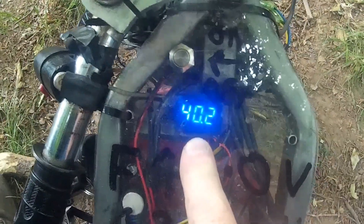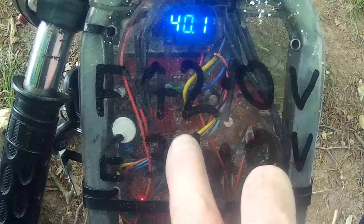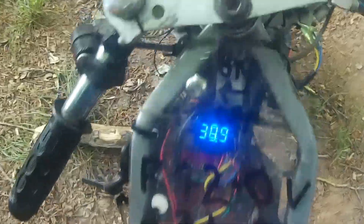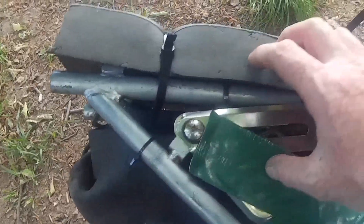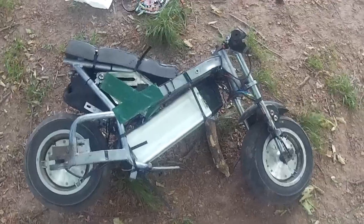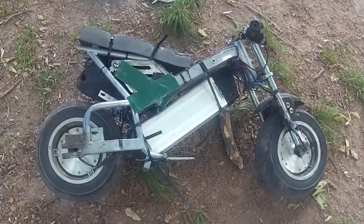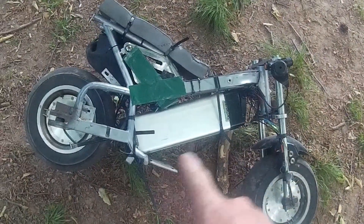There's a little eBay voltmeter so I can see what the voltage is doing. Full voltage is 42 volts, empty is 31, and of course under power the voltage droops a bit. I originally ran it from the original hoverboard battery, strung up under a bit of inner tube rubber under the seat. But because both wheels with the larger tyres are continuously running — bearing in mind the original hoverboard only keeps you balanced upright — running continuously for whole minutes at a time was a bit much for the small battery. So I've got a little e-bike battery, which for an e-bike is a bit old and tired, but for this it's just perfect.